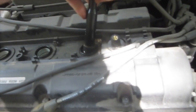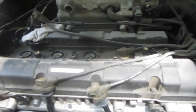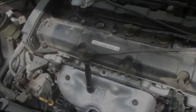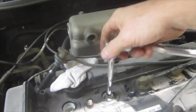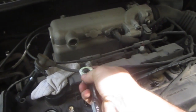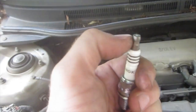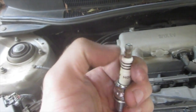Grab your spark plug wire and press it down — you need to be very careful to keep these holes clean. You don't want to drop any foreign objects down in there because you're going to cause engine problems. Just pop the wire down and it clicks right in there — that's all you need to do. Sometimes the socket doesn't want to come back off the plug; I just give a little bit of side torque to pull it out. If the spark plug absolutely won't release the socket, just flip it and tap it lightly in the other direction — that allows it to release. Some cars won't use this top piece on the plug; if your old plug didn't have it, it just unscrews off. This is the way your wire connects — some connect straight onto the threaded piece.